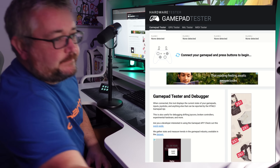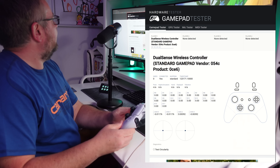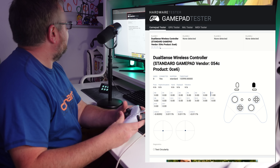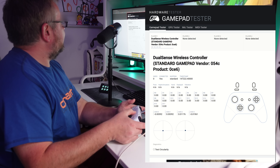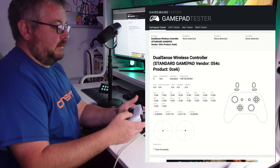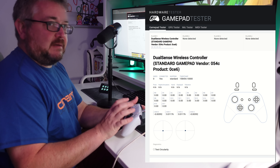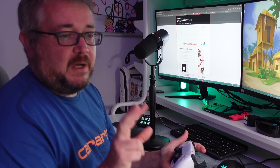So that's that one sorted. This is the one that doesn't come on at all. I'm going to try plugging it in to see if it recognises it. Yes, it does — well, that's interesting. Let's try the buttons on this one. All the sticks work. The D-pad doesn't work. Start and select work, the middle one does. The power button doesn't work — that's probably why it isn't coming on. And none of those buttons work: triangle, square, X and circle. So there's quite a lot of buttons out. Is that going to be a ribbon cable issue? Let's get them back over to the blue mat and start with the one where there's just two buttons that don't work — hopefully that's an easy one.